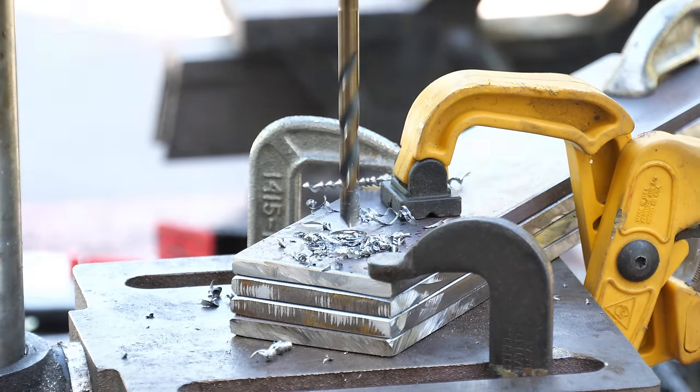We will have to reconfigure the exhaust mounting bracket a bit since the position is lower than before, but it seems like this stud should work. So we'll do it all over again on the driver's side. The main difference here is that we drilled our own access port instead of working with one already in the channel. The rest of the process went smoothly, and pretty soon we've got a second stud ready to go.